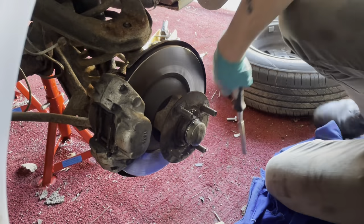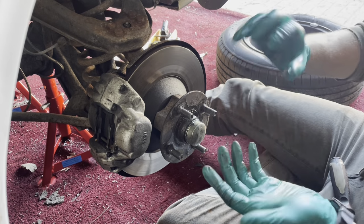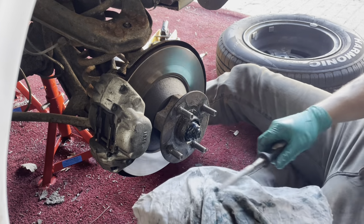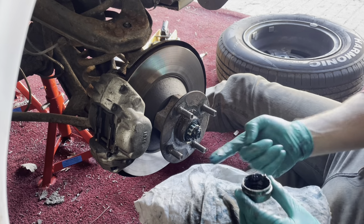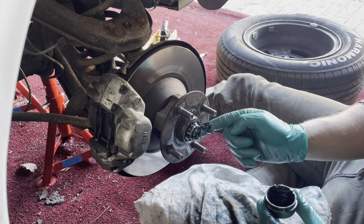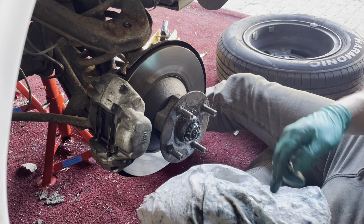So the bearings on these are pretty simple. They're just two washers that push like a cone bearing into them. What are they called? A needle bearing. So get me rag out. So underneath here, there's a bolt, there's a nut covering, which is sort of like a retainer cover, where you tighten the bolt up and then you put the cover on, put a split pin through it that holds it all together.